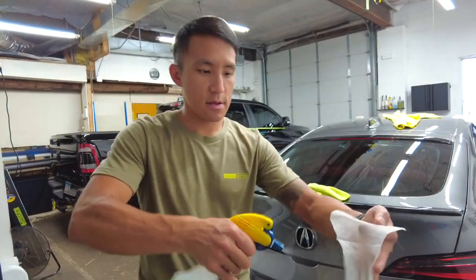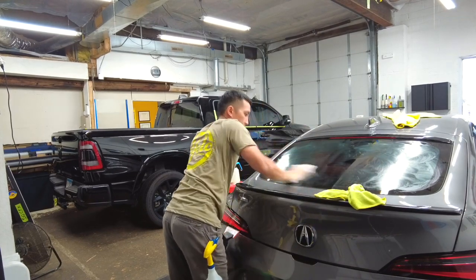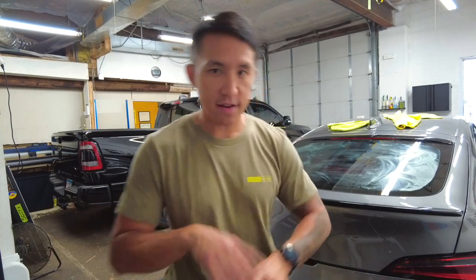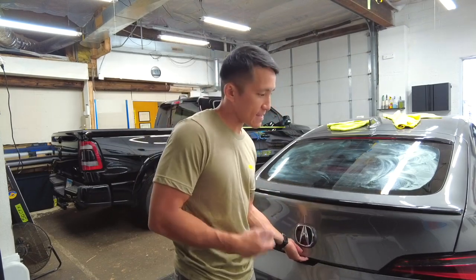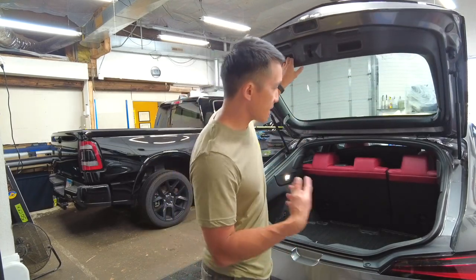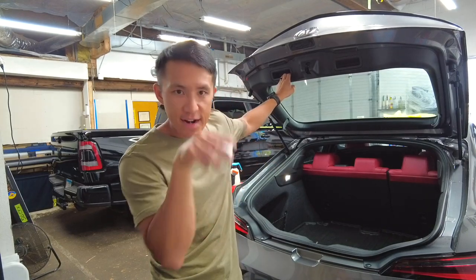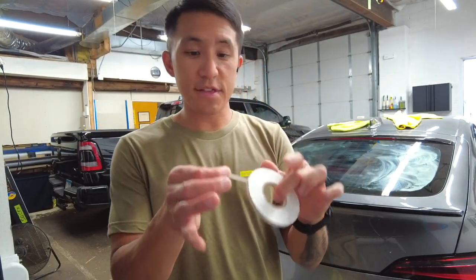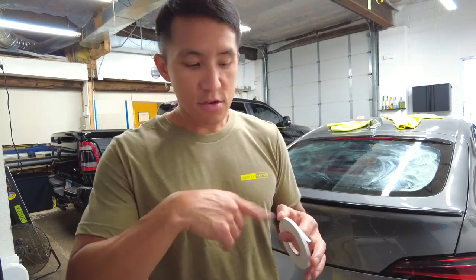Spray the glass with a dryer sheet spray — the goal is just to dry that out on the glass. Apply it and make sure it covers all the glass all the way to the black edge, then let it dry. There are two ways to cut the back window: if it comes out of the plotter it's great because you already have a pattern. If you don't have a pattern, you can go in from the back. Since this is a hatch I can crawl in there, which makes installing easy. Another option is to use tape along the dot matrix — this prevents scratching the glass, and once the tint is on top you just trace on top of the tape.